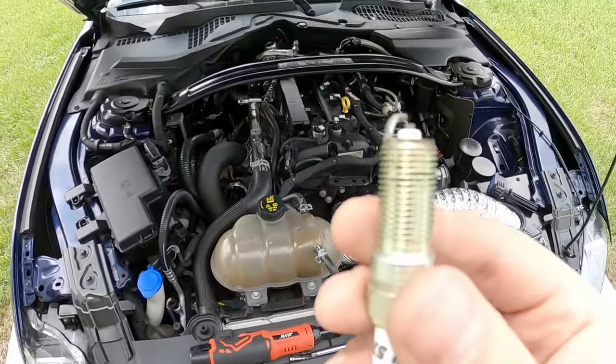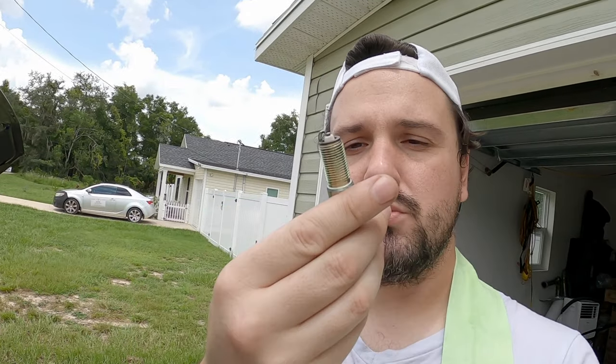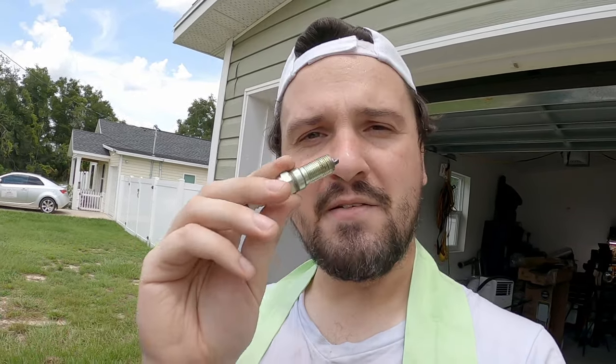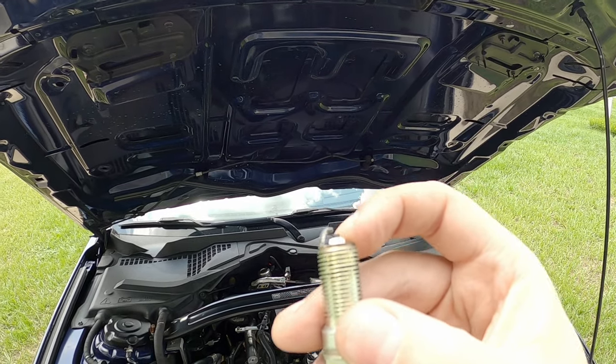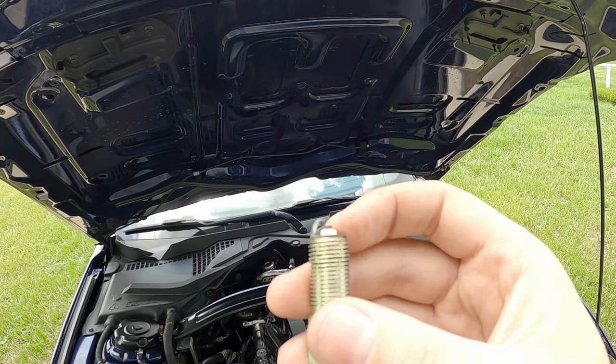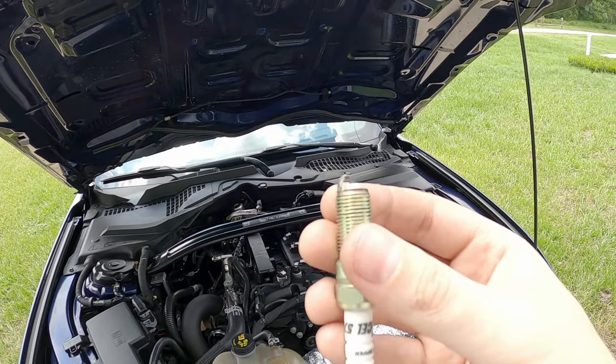So that's when I thought maybe I need to give it a shot. I have all of these side-gapped plugs, and I've already done the runs with them before I modified them. These are the two-step colder plugs, and I've had some interesting results in the past with these making the car faster. I also chose these because they're a lot easier to side gap being copper core plugs — not crazy iridium or platinum — and it's $20 worth of spark plugs, not $60. So let's go ahead and take a look at the baseline run I did before I gapped them.